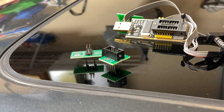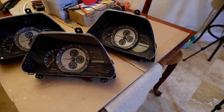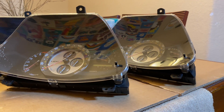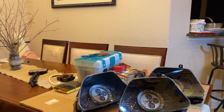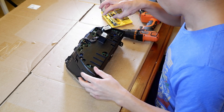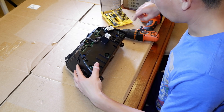Now that we've had a quick lesson in EEPROM programmers and electrical engineering, we'll go ahead and open up the cluster. I've got three clusters I'm going to be messing with: my original cluster, the manual cluster, and a 2001 cluster I got from the junkyard recently. That one is a little different than the 2002 to 2005 version because the pinouts and wiring are a little different. That one is worth a bit more because there are fewer available. Before we get started, we're going to take apart the four Phillips screws. There are two other tiny ones that need a precision screwdriver near the A harness, and one up top for the lens.